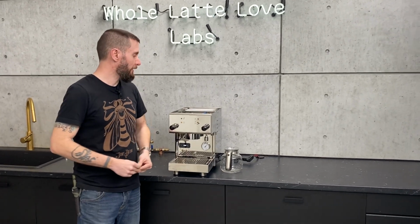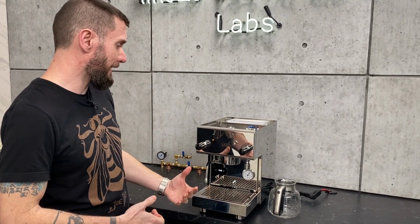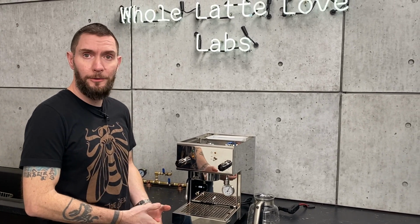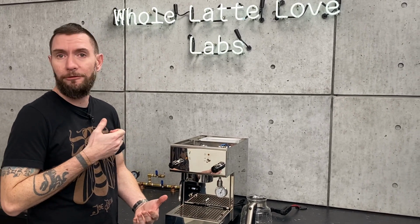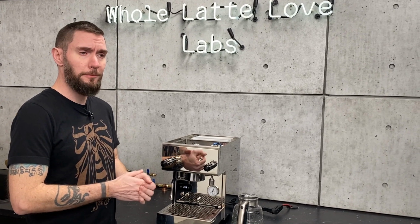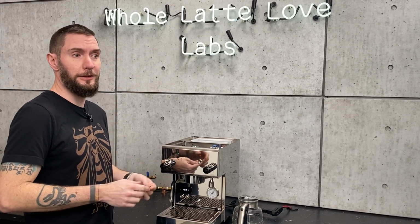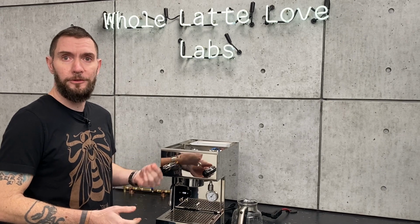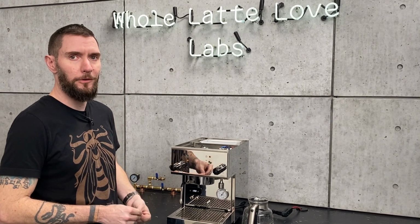All right. So we're going to go over a few different instances, typically why you would want to drain your boiler. If you're trying to get all the water out that you can before you're doing some service on it, if you're putting it into storage, if you're getting ready to ship it out, especially if you're shipping during the winter months, and especially if you're shipping to us during the winter months. We live in upstate New York and it gets really, really cold here. So to prevent any kind of damage happening to your boilers from freezing, you want to make sure that they're as empty as possible.